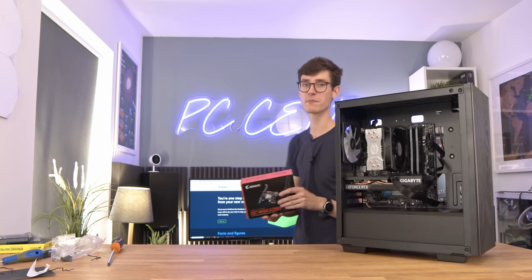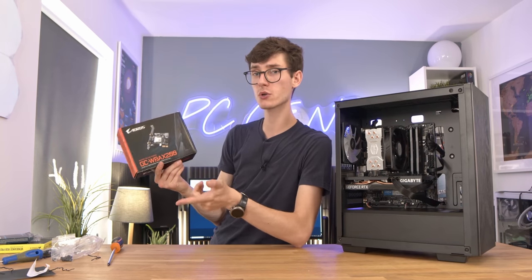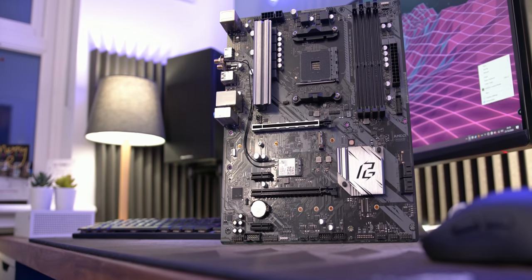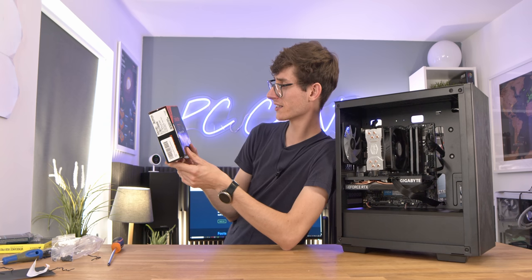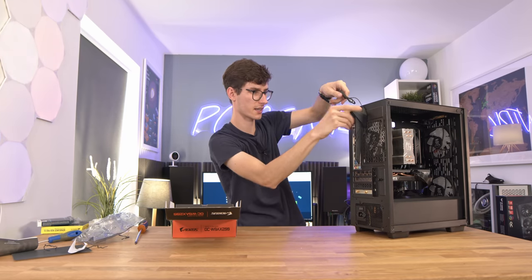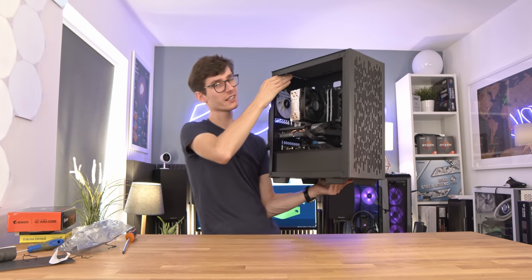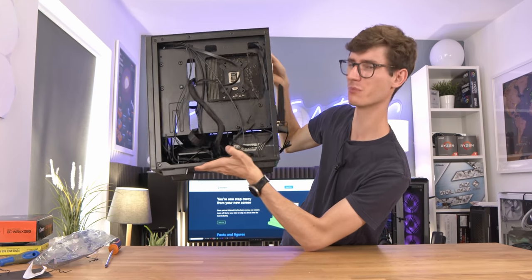For me there is still one more component to install — the Wi-Fi card. Just be aware that not all Wi-Fi add-in cards will have a high-end Wi-Fi chip; a cheap chip might only get you 80 Mbps down, whereas something like this in theory could get a gigabit per second. Take it out of the sleeve, line it up with the lowest PCIe slot, tighten it up, then grab the little magnetic antenna and plug it into the Wi-Fi card. And here is our hopefully working finished PC — with no cable management around the back there's really not much to do, maybe a couple of minutes and two or three cable ties.